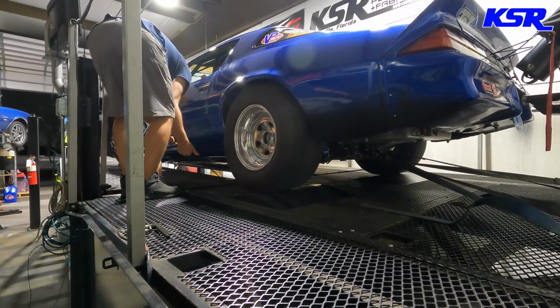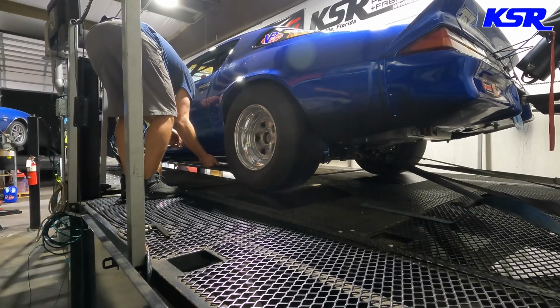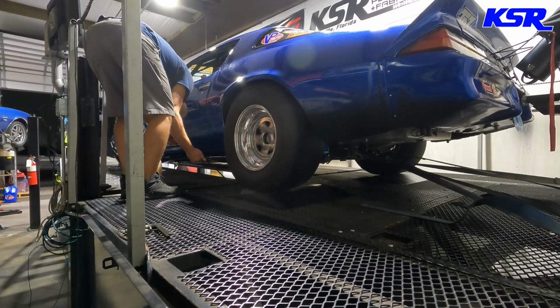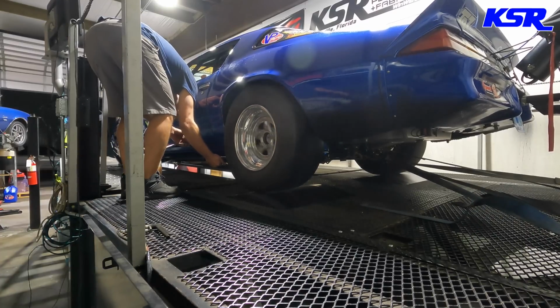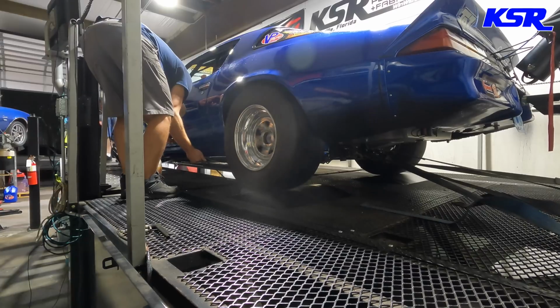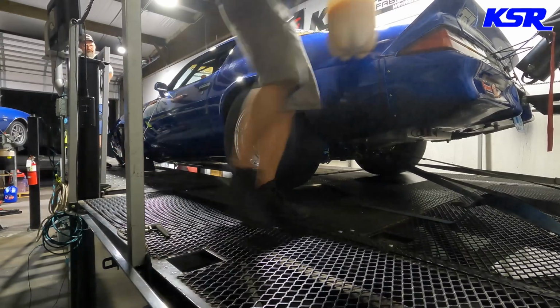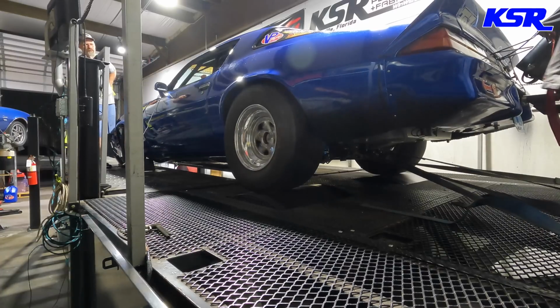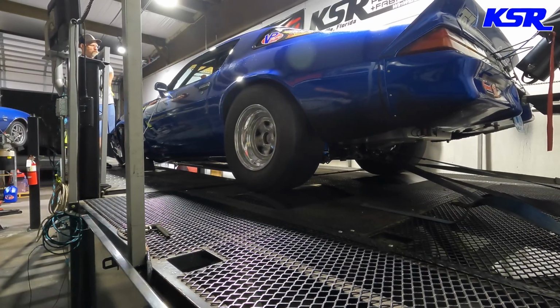It's just a garden sprayer that I'm using for this stuff. So you put the methanol in it so it'll still flow and not gum up at the tip and in the trigger mechanism. It's not a fix-all. I will say that it still ends up where we have to take it apart and clean it every few months. But pretty much everything that we think is going to put down some decent power, we go ahead and glue the rollers. Now, unfortunately, that does make a mess on the back of my dyno here behind the tires.